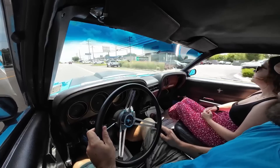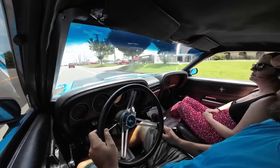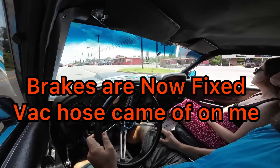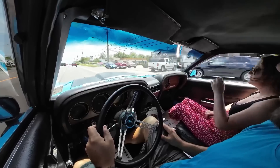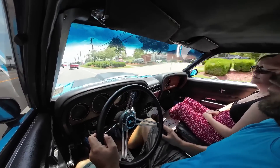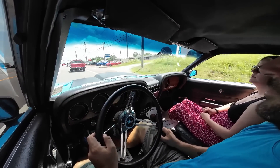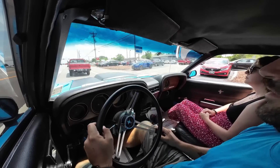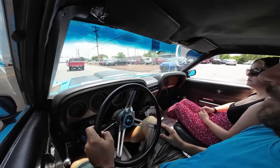When I get into the throttle she's got plenty of power, but the kickdown is not hooking up on this one. Brakes feel okay, a little stiff on the pedal there. You can hear that carburetor open up — she's pulling good. On the brakes, it is a stiff pedal, so you do got to apply a fair amount of pressure. It's like disc brakes but with a stiff pedal — almost like manual disc brakes.